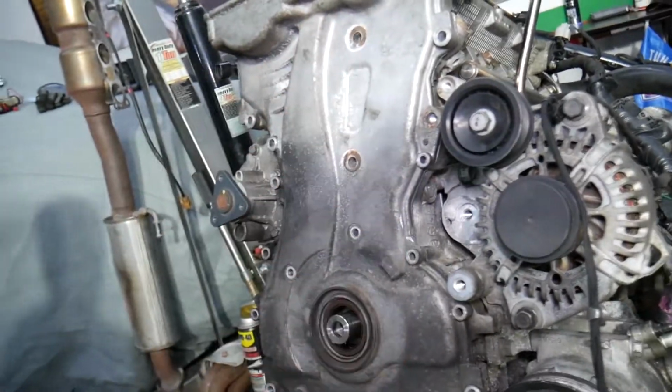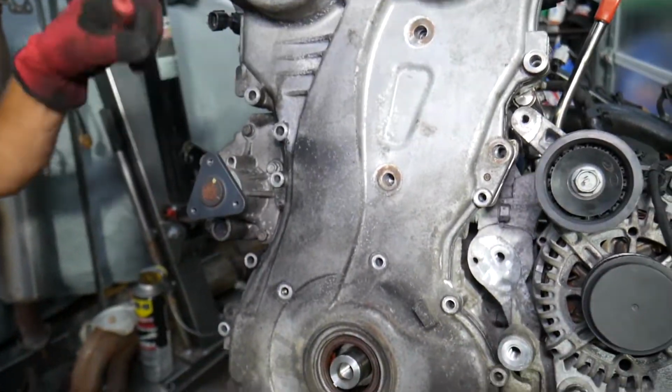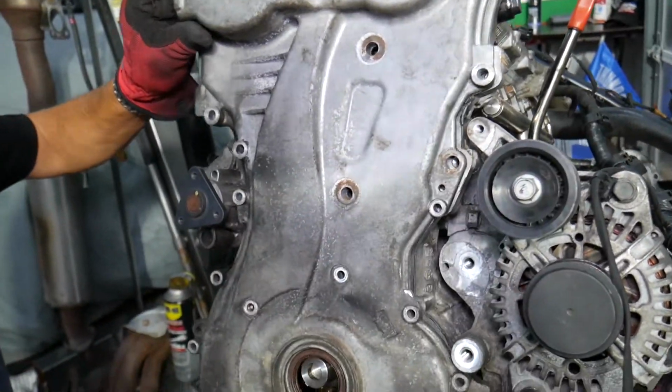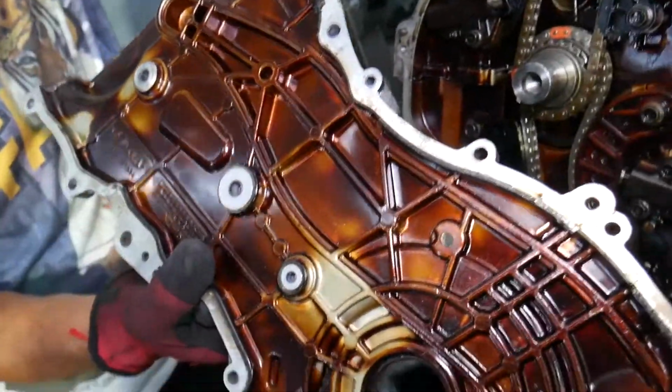You have silicone sealant that can be stuck, and these 2 metal guides, don't pry too much. If you do, you can crack it. If it doesn't go, just go a little bit here on every angle. That way, okay, it can come loose, because if you don't pre-treat those, you don't soak them, it'll be really hard to pull that timing cover.